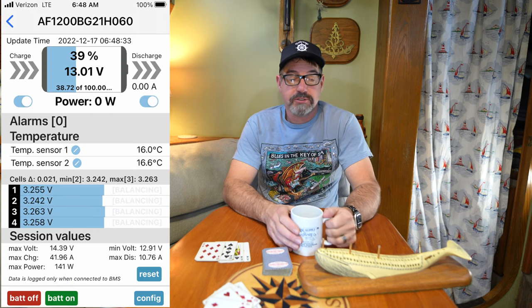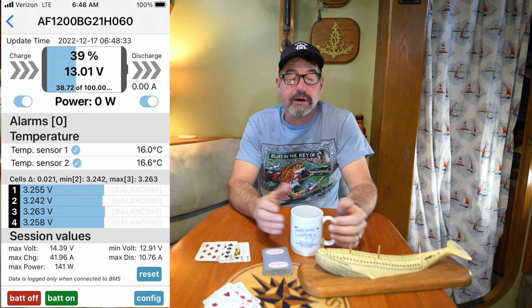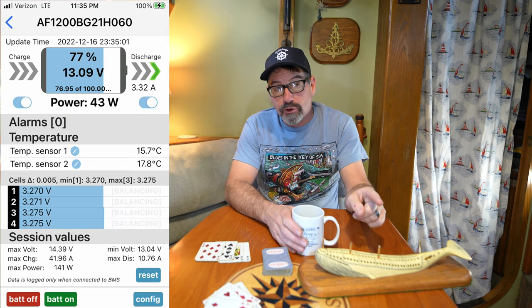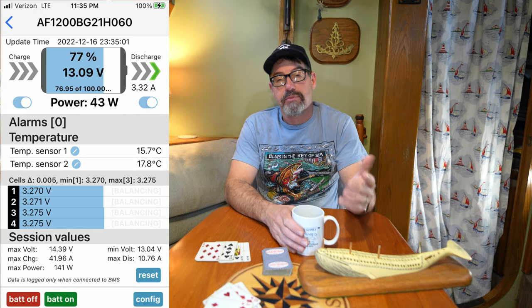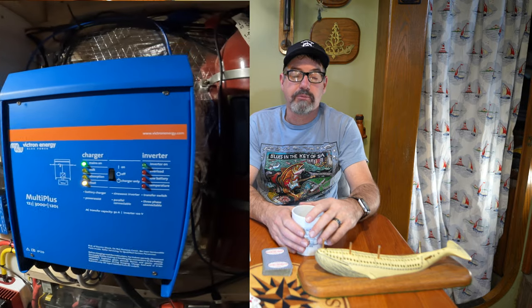That worked out perfect. The little battery thing from Art's — the BMS showed that we used 61% overnight, or 61 amp hours, the way it was set up. We did have to run that fan just to keep the inverter going, otherwise it would go into sleep mode. With our Victron MultiPlus, we have no issues with that — it works just fine with the electric blanket, but I wanted the independent testing. The fan used 3.2 amps, so that used about 35 amp hours. We did a 10-hour test, and the electric blanket shuts off at 10 hours.